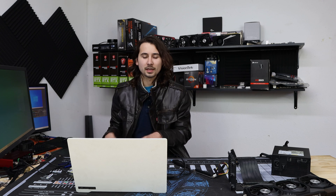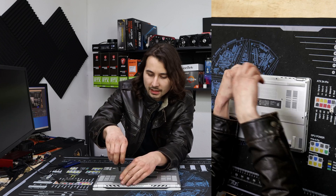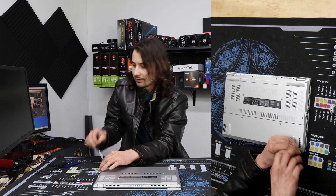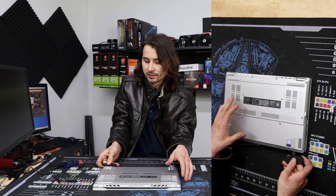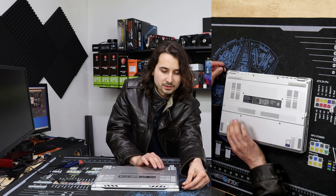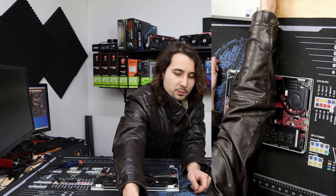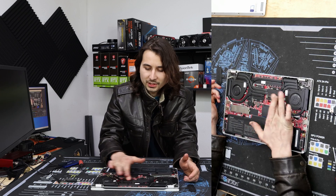I'm going to go ahead and turn the laptop off, flip it over, and take the back panel off. There are 14 screws on the back — pull all of them out. The last screw kind of pushes the back panel off, which is very convenient. I just use something plastic to stick in and pull up the edge. Go around the outside with the plastic tool and it will usually keep all the screws in there. Set the panel off to the side — beautiful red PCB here, foreshadowing for things to come.